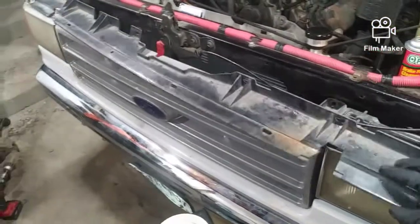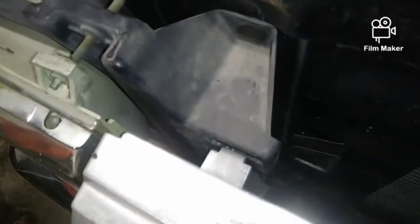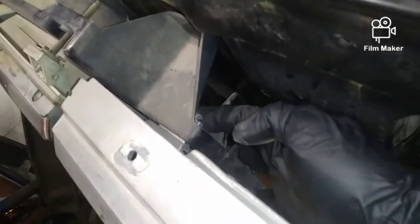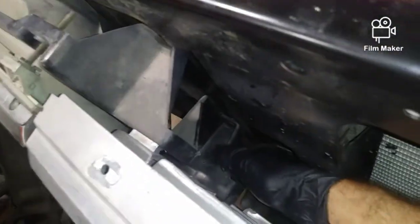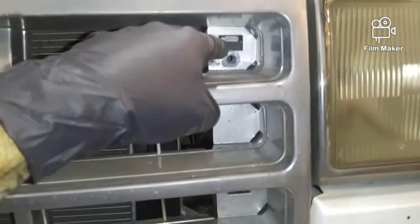This comes off just like this. So now let's say you're at the grill. This is actually really easy — it's just C-clips. What you do is take your finger and push up on it and pull up the grill at the same time, just like that. You can see how the bottom one stuck on me — I'll just pull up on it and it comes right up. The other side is the same way. If it's still stuck, there might be a screw holding it in — look for holes like this. There might be one on the other side too.